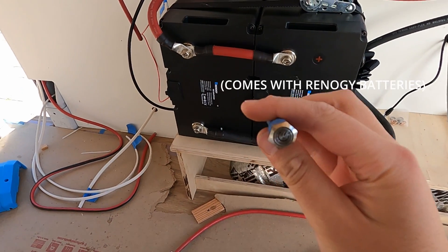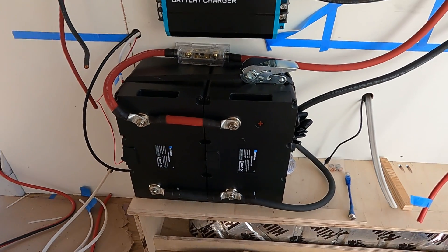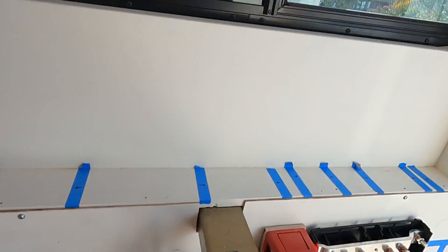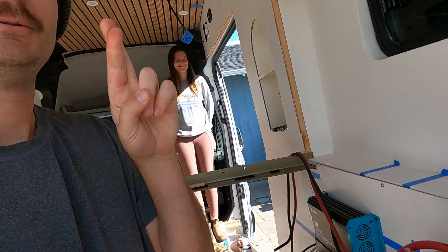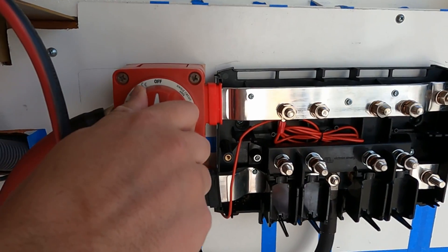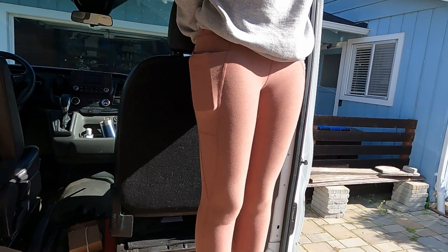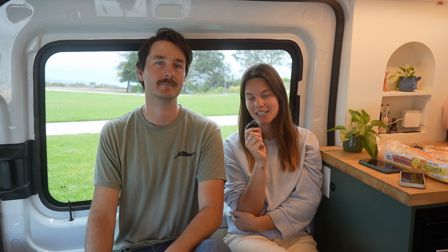I'm using this switch in the up position to turn the batteries on — it lit up bright blue, that's how you know it's on. Something to note about battery cables: the positive and negative cables should go on opposite terminals of each battery. The reason is so both batteries drain equally at the same time and you're not overworking one battery over the other. We're going to try turning on our system for the very first time — hopefully nothing blows up. It's powered! The display reads zero percent — but it's on. Thank you for watching our electrical video. Stay tuned for next week where we'll be putting part two up.